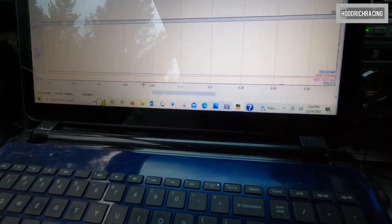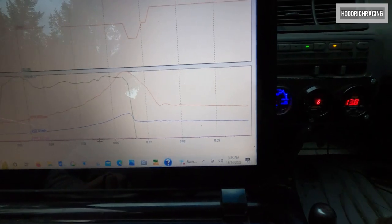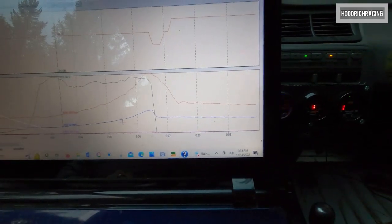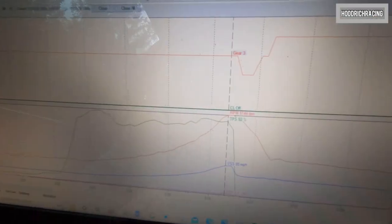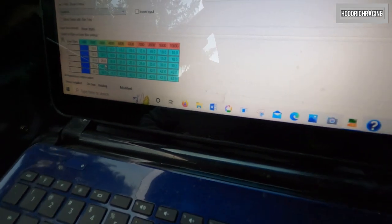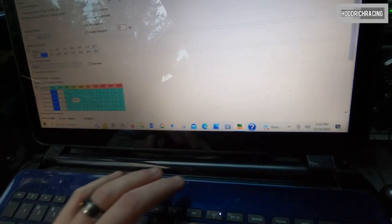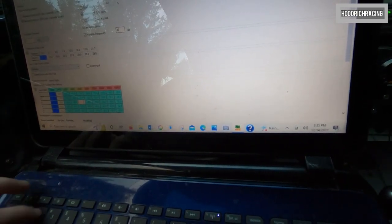We can just go all the way to the end of the recording — this is just me cruising to the stop. So it looks like we actually ended up bringing the boost down from around 30-something percent, which is about 13 PSI, to 25%, which brought me down to nine PSI. This is kind of a damp surface and it actually hooked pretty well. I can probably up the boost a little bit. So let's go back into the parameters — let's go to boost control, and we can bring the boost up. We can't exceed 42% or else we're going to boost cut. Let's do 29% duty cycle and see what that does. This is not going to be done in a 15-minute drive — this is something you take your time with.